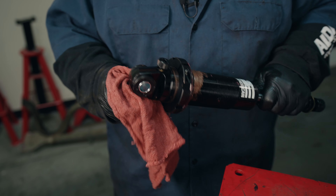We're ready to start on our rear. One of the things we found on this car is that the way the tailpipe was made, it's going to interfere with the coilover shock. Occasionally we'll find that, and so far of all the coilover kits I've done, I've only had two cars that required removing the tailpipe to make a new one. The next thing we have to do is on the upper mounts at the frame — the bolt holes have to be drilled out to three-eighths of an inch, as the original hole is designed for a loose five-sixteenths bolt but we replaced the hardware with three-eighths.